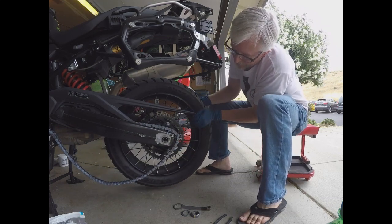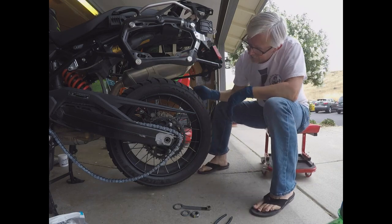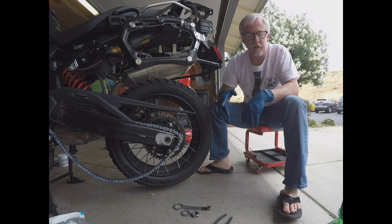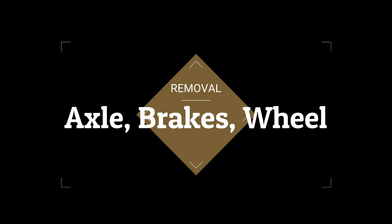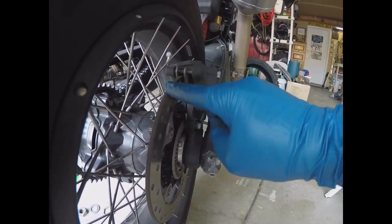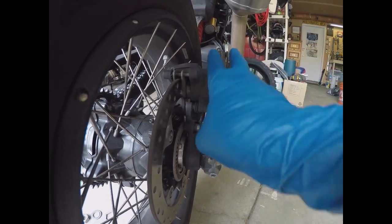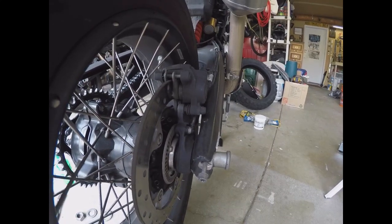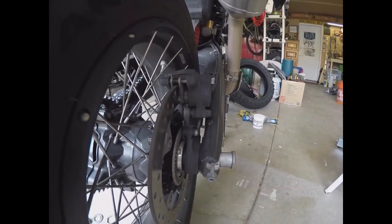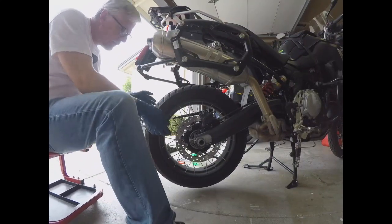With that out, I can get back to a more natural position. If I remember rightly, this tire doesn't actually like to come off — the wheel doesn't like to come off so well because of the brakes on the other side. As soon as the axle's out, I've got to lift this thing off of the rotor, or pull the wheel down off the rotor, then rotate it out from the swingarm. And when you put it back together, it's kind of got to come sliding back in as the wheel comes back up all at the same time. We'll see if I curse and have to bleep it.